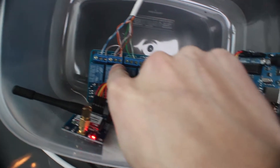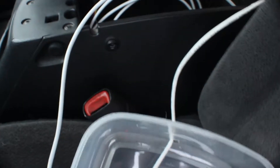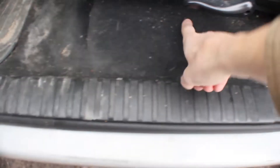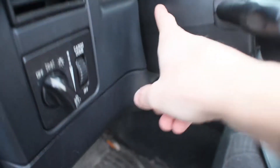This wire is carrying all three ignitions, the starter, and parking lights. So we have ignition, starter, and parking lights here. That goes through the center console, down under the seat, then into the carpet, runs under this, and gets spliced into the parking lights around the relay. The other wire is the ignition that goes up right there.